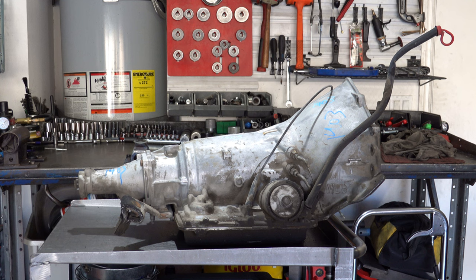Now, '88-'92 is one vintage in the late generation, and then '93 is kind of a standalone. In '88-'92, they eliminated in the valve body the valve train and bore location for the mechanical torque converter clutch lockup. So '82 to early '87, those valve bodies were provisioned for that, but '88 and up, it went away. They eliminated the casting and the bore entirely.